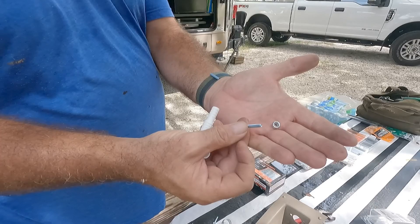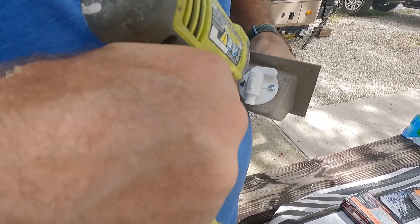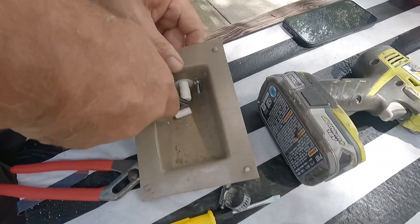The drill — that's the only way you can get them off. If you do it any other way, you're going to ruin whatever you're working on. So I drilled them out and got them off. I saw that the rivets weren't going to work very well, so in my — I call it my bag of tricks — I keep a bag with tools and extra screws and nuts. I had a couple of locking nuts and a screw that was perfect, so that's what I used. The nylon locking nut is perfect. So I put that on, secured it, tightened it down. Then I cut off the excess piece of the fitting because we have the larger size hose.